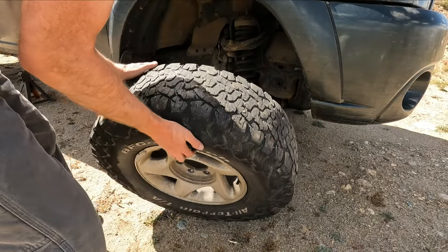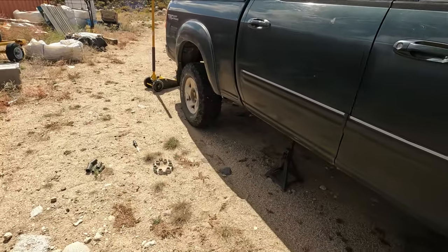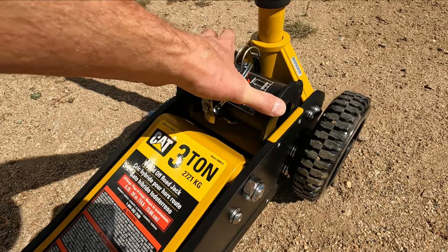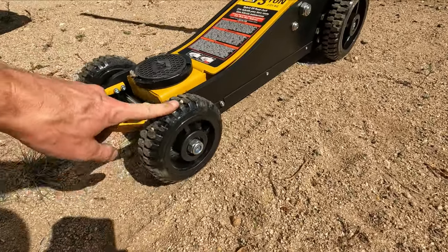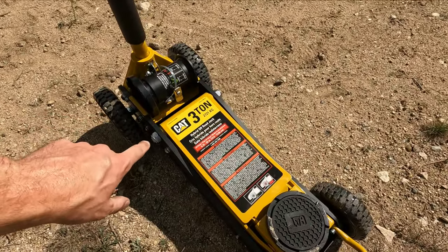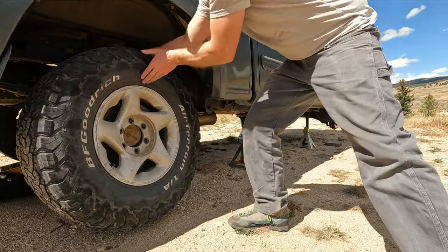First wheel is free. For this rotation we're going to do the rearward cross — this is a four-wheel drive truck. The front tire goes to the opposite side in the back, and this back tire comes straight forward. The extension raises it all the way up to the 29 and a half inch lifting capacity. This thing isn't cheap at $450, but that's $180 cheaper than the next competitor with big wheels — I'll have a link below.